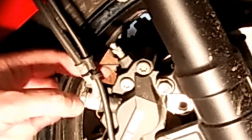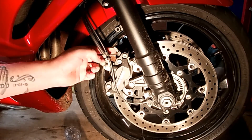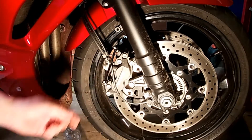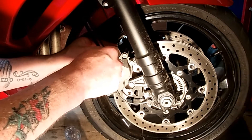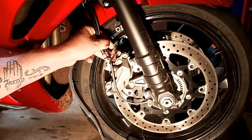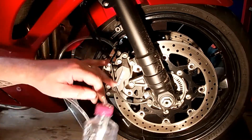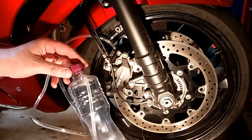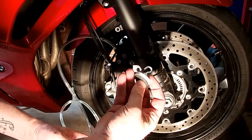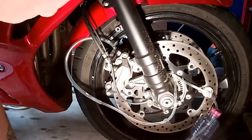This bike is fairly fresh, but you might have to put some releasing fluid on there or heat it up to let the aluminium expand from the steel if it gets tight — but it won't be a problem on this one. I'll just pinch it open, then closed, just to make sure I can move it. Now I'll get my pipe and place it over the bleed nipple, push it through the slit in the bottle top to catch the old fluid. I've got a magnetic hook which I'll hang on the brake disc out of the way.